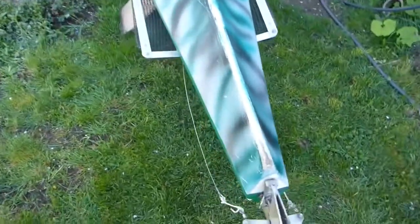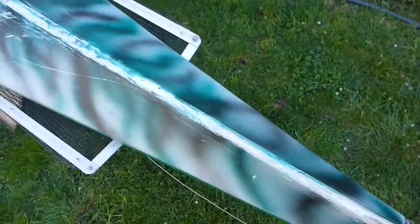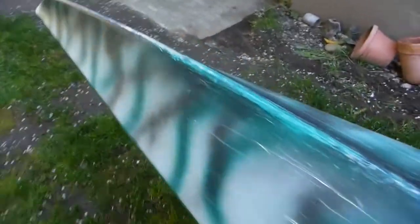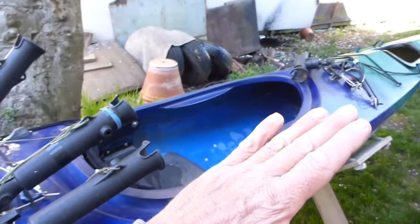This kayak has sprung a leak. Trying to find the hole — it's not exactly obvious. There's no exact puncture marks, but the two areas I suspect most are the wear points on the back end keel and down on the front where I've got some wear on the bow strip. It's slightly tilted up, so I'm going to put a few gallons down in the rear hatch and see if I can get this area to leak.